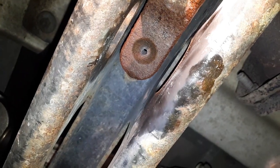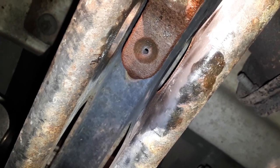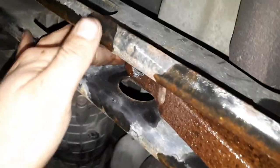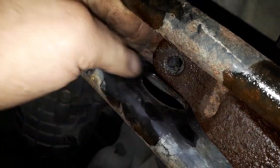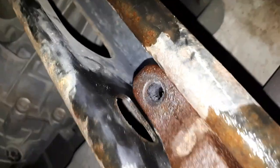So that's the 1/8-inch pilot hole and I'm about to drill about a 3/8-inch hole for the bolt. I've drilled a hole in this torsion key — it's about 3/8ths. I'm in Canada so we use metric; I'm not sure of the exact metric size, but it's about a 3/8-inch hole.